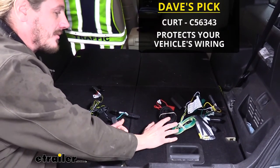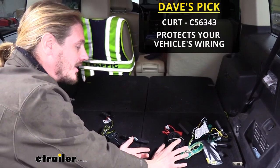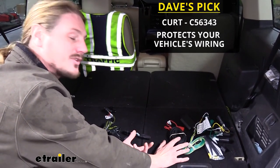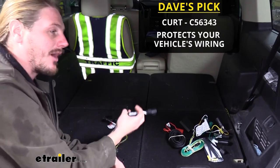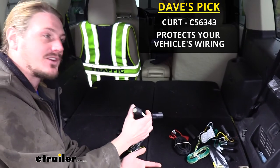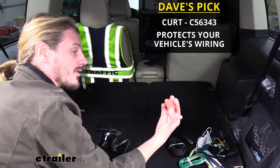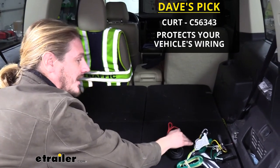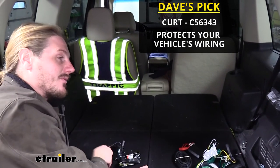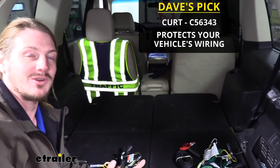Overall I would choose the Curt because it's going to protect your circuitry on the vehicle, so even if you have a small trailer you don't have to worry about an issue. The other reason I choose the Curt is that even if you have a small trailer and the Tekonsha would have enough power to operate it just fine, in the event you have any shorts that occur on that trailer, the Curt's module will catch it and either shut down the circuit or open a fuse that only affects your trailer. With the Tekonsha, a short is going to open a fuse in your vehicle and result in a loss of lights at the back — which is unsafe not only because you don't have trailer lights, but you also don't have vehicle lights.